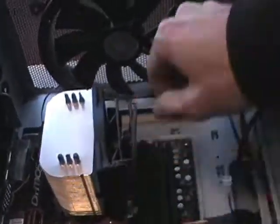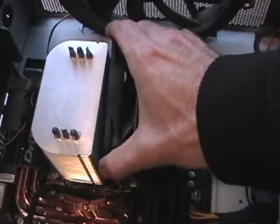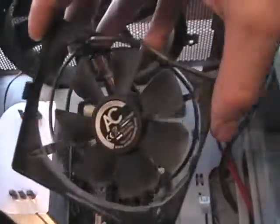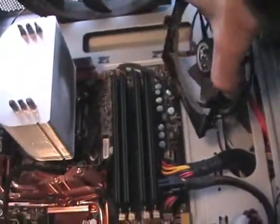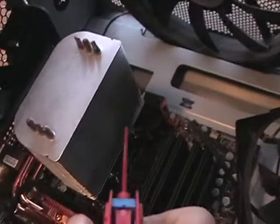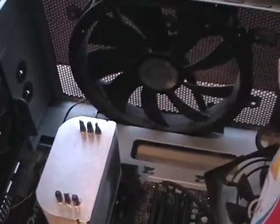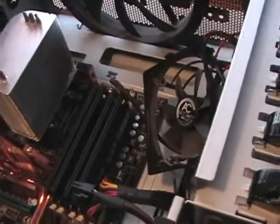What I'm going to do is unclip my fan. As you can see, it's not that bad — a little bit of dust but not too bad. Nice short controlled bursts — you don't want to get too crazy because the CO2 will start freezing some of your components, and that's the last thing you want to have happen.